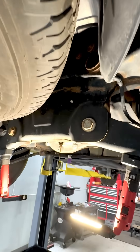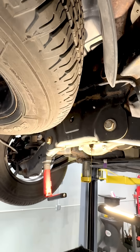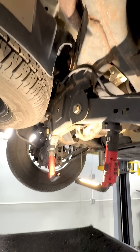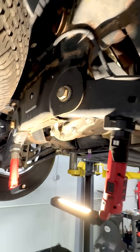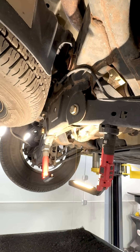So we're going to go ahead and change the fluid on this one. It's very important that you use that friction modifier. The electronic locking differentials on the F-150 do not require friction modifier — that's where the confusion lies. People think they're all just electronic differentials, the same thing, but this is totally different, totally new technology on the Expeditions.